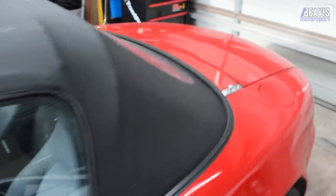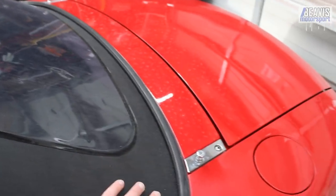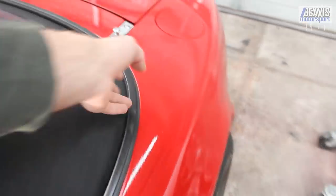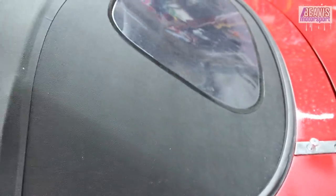As we move further down to the back of the car, in the roof and in this channel here, is what's called a rain rail. Down in this gap all the way around the back of the roof is a rail of plastic which carries water that falls on the roof into rain channels. If any of that has failed, corroded, or the plastic has deteriorated, you can get water in the boot or in the rear parcel shelf. So keep an eye out for any wet patches inside the back of the car or into the boot.